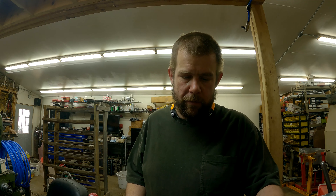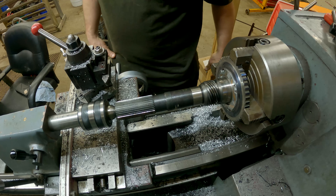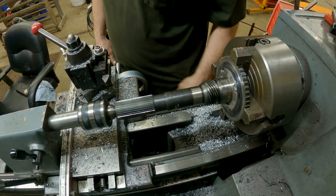I'm gonna do a quick little video on how to cut a turbo 400 output shaft on the lathe. Most of these shafts come out of trucks and they don't have a slip yoke and they're not cut properly, so if you want to put it in a drag car you've got to cut the shaft to fit a slip yoke properly. Most folks aren't gonna have a lathe, but they can probably source it out to a local shop. As you can see, the splines stop and the shaft gets bigger — all we're doing is changing that. We're gonna cut it back not quite to the speedo surface, just cut it down to that diameter.